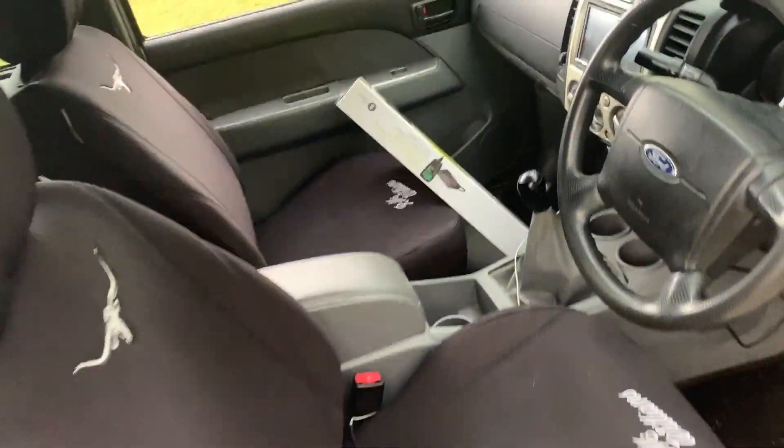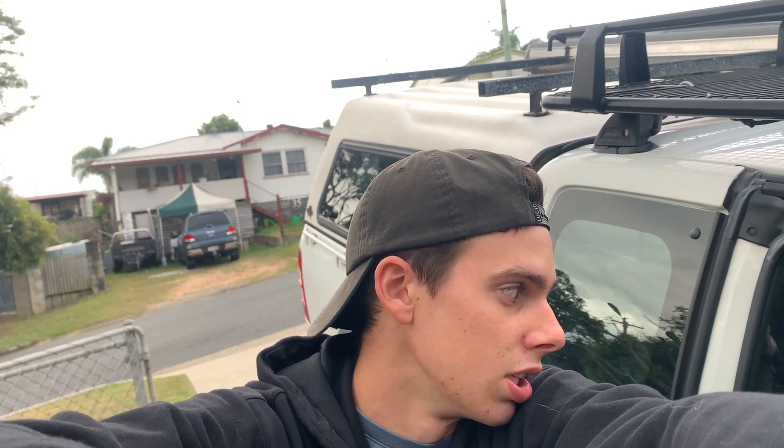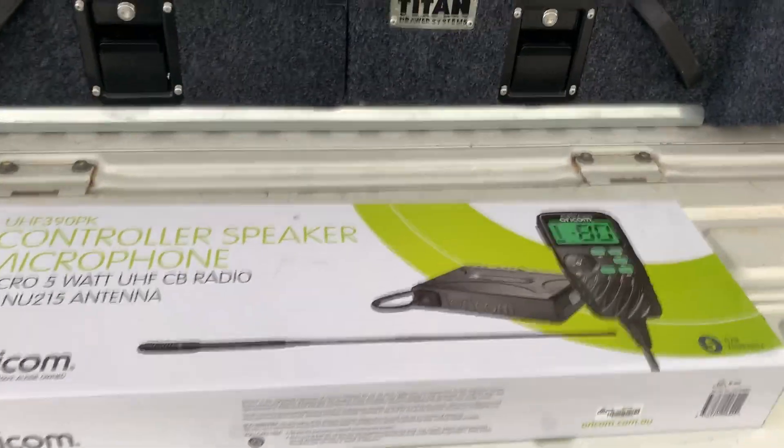Okay, so as I said in the last video, I'm on the UHF today. Pretty keen for this because I'm going away on a trip in four days - but by the time you're watching this we're probably already on the trip since we space the videos out. I said in the last video I was going to do it using a fuse piggyback, but I've changed my mind. Looking through the instructions, you can actually set it to turn off after a certain time of not being used, so I'm just going to wire it direct to the battery. I can set it to turn off after like an hour of not being used, which hopefully won't drain the battery too much or leave me stranded. Should be fairly easy since we aren't messing around with fuse taps.